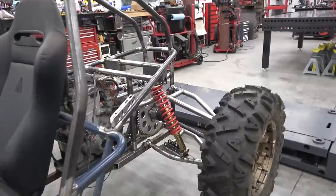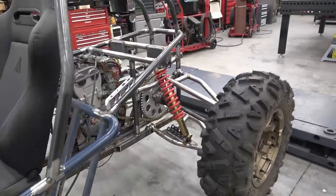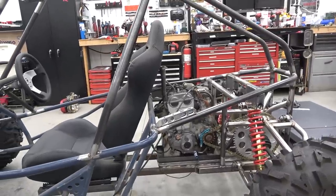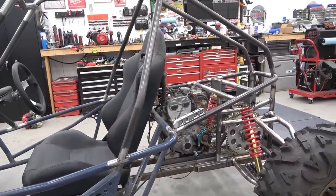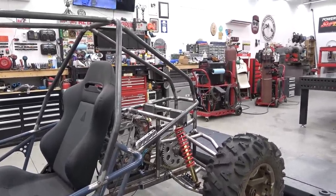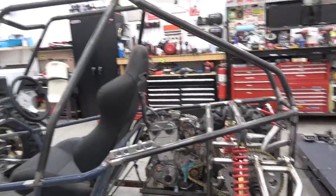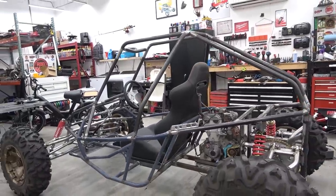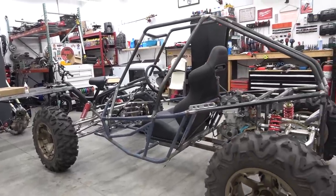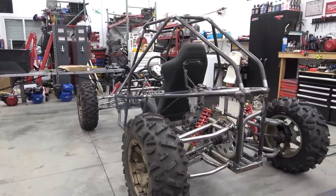On the rear, the body of the shock is touching. I need to figure out what I need to do to get that to clear — the shock needs to be closer in. It's a little too stiff. There's still a lot of weight that's going to be added: the oil tank, the exhaust, the radiator. This is a dry sump engine, so it doesn't hold oil inside the block — we need to make an oil tank and a gas tank. There'll be more weight added, so I really don't want to mess with the rear shocks too much right now. I want to wait until I get as much weight on it as possible. I think everything turned out really good.